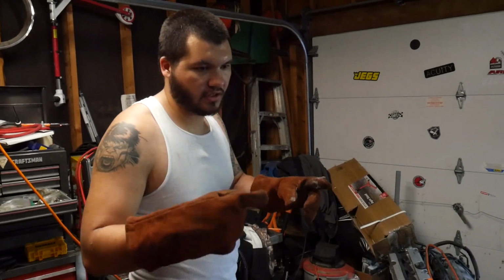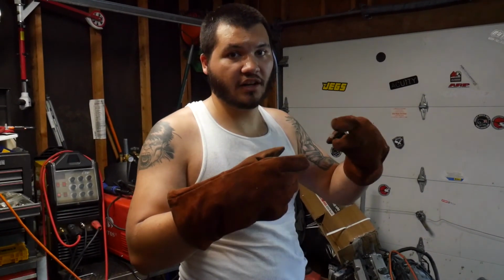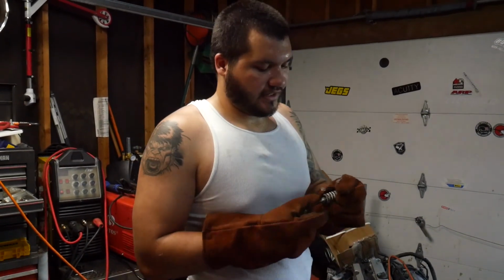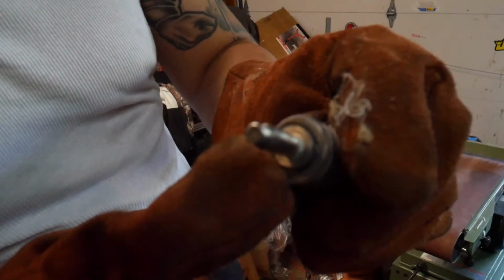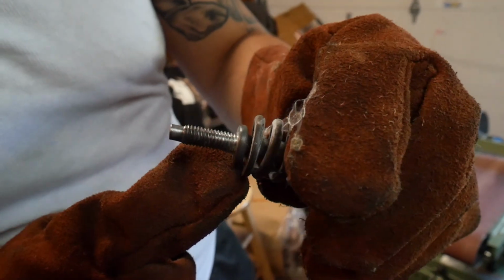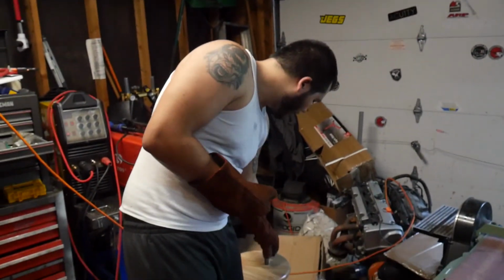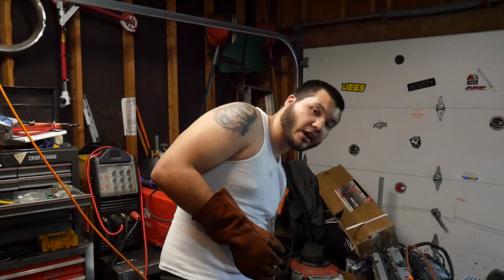So with my exhaust, where the bolt goes through on my car, you can thread the nut onto it so you can connect the exhaust pieces. There is a spot where this little ridge hits on it, because this exhaust is an OEM, so it's not going to account for that ridge. So I'm just going to grind it down a bit, and that should allow it to fit. And then from there, I will be able to put it on and keep my exhaust from rattling.